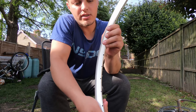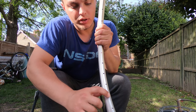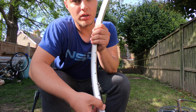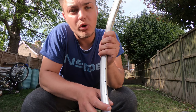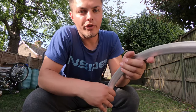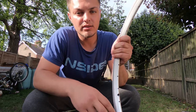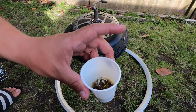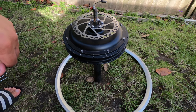So I will use a single cross pattern, and if you can see here, some of the holes are offset, and I will use the lower offset holes for the lower flange spokes and the upper offset holes for the upper flange spokes. And one more thing on the valve, the spokes that will come on the valve won't be from the same pair. So one will be from a pair and one from another one. Here I have the nipples in some engine oil, and the motor is on a stand, so it's easier for me